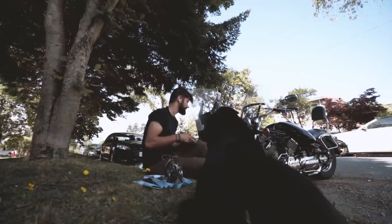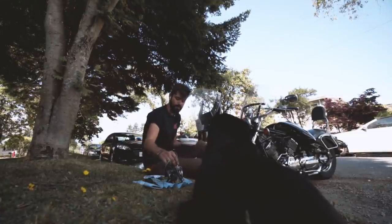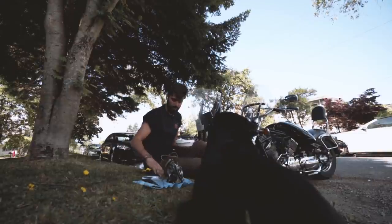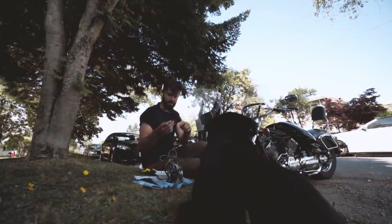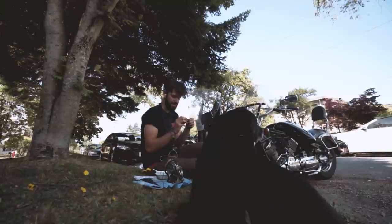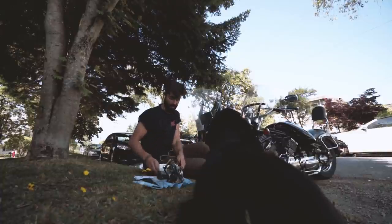I didn't film it, but as soon as I turned the fuel on via the ignition, the gas just started pouring out the flood valve, this tube over here, and once it goes out of there, it kind of comes out of everywhere, so it's kind of a mess. So it means that these valves in here, the float bowl sits up and pushes a valve into these, and there's a little filter on them, a little rubber gasket, and that keeps the bowls from flooding. Those haven't been working. Ironically, I just took them out and cleaned them, and they look fantastic.